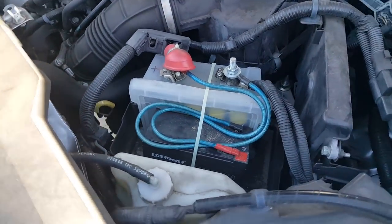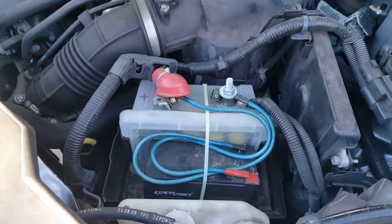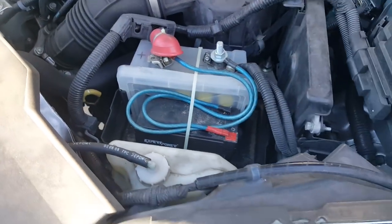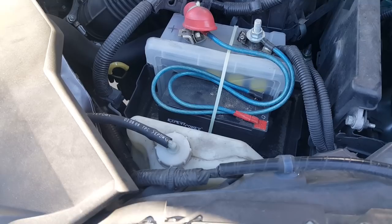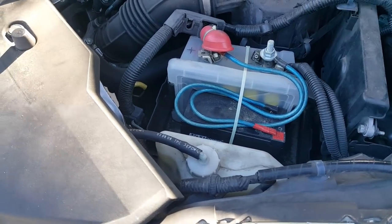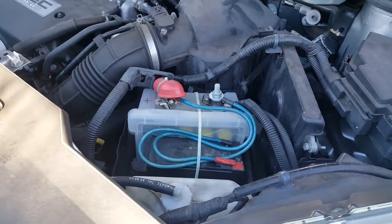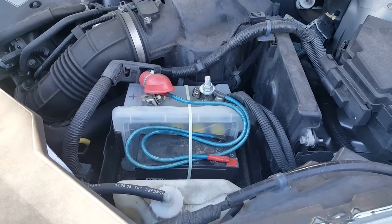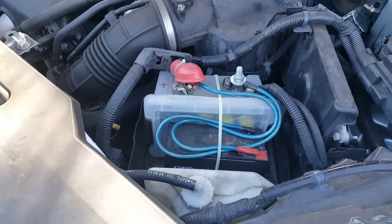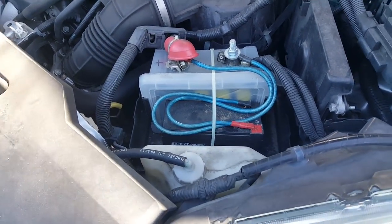For some reason there are people on the internet who just don't believe it, and I can't fathom any reason to pretend like it's working. This truly is, to me, a good alternative to a car battery. For the average person it probably wouldn't be ideal just because of the small amount of reserve power, but you can get six 3,000 Farad or bigger capacitors assembled together — about the size of a regular car battery — and you wouldn't even need a backup battery.